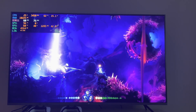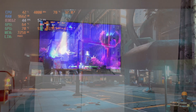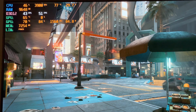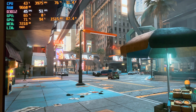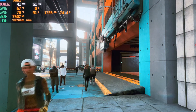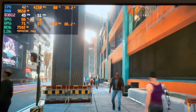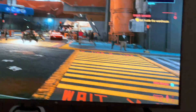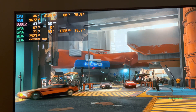Here's the setup — the computer has no ventilation underneath, just a stand. Playing a simple game: 60°C GPU, 62°C CPU, runs smoothly. Testing Cyberpunk — probably the most demanding game I have — in a busy scene it's around 75–76°C for the CPU and low 70°C for the GPU, with DLSS and everything on high with ray tracing. I can hear the fans a little, not perfect, but pretty decent. Very happy with the repaste and overall stability — definitely way better than the original unit.